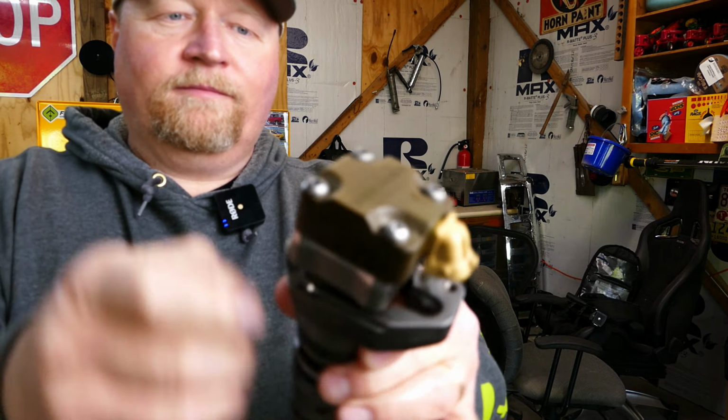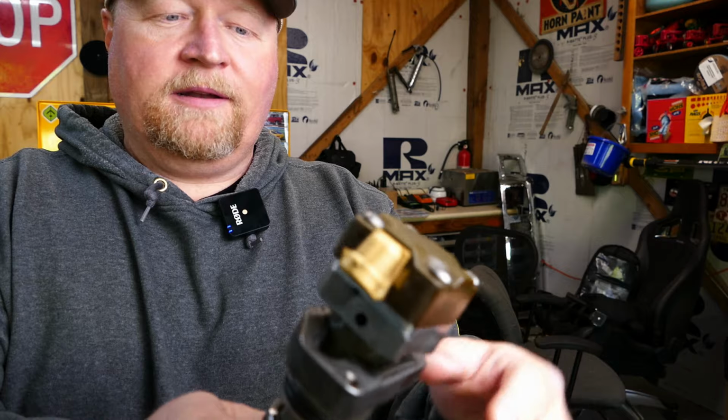What is buzz? Buzz is the little electrical solenoid that sits on top of the injector. This solenoid right here on the top is what we're buzzing. It actuates the passageway for the high pressure oil to mash a plunger down and squirt diesel fuel down into the cylinders at extreme pressures, right? So that's what I'm listening for. This solenoid has a pronounced loud click to it, a very crisp click, right?